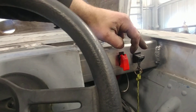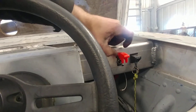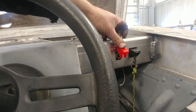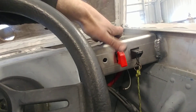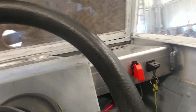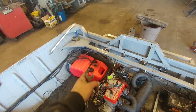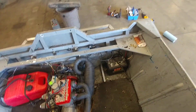This is a kill switch — I'm going to wire these together so that down is off and up is on. And here I'm going to do a push button start — a 'please steal me' push button start. I have a way to make the boat unstealable but I'm probably not going to show you that. Fuel tank is mounted with bungee cord and batteries are mounted with bungee cord.